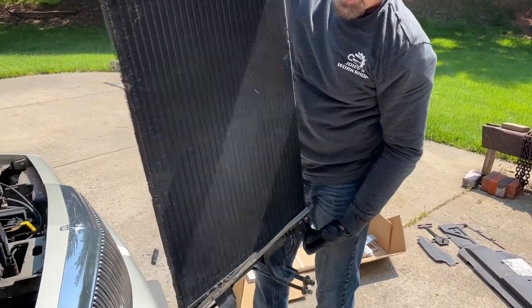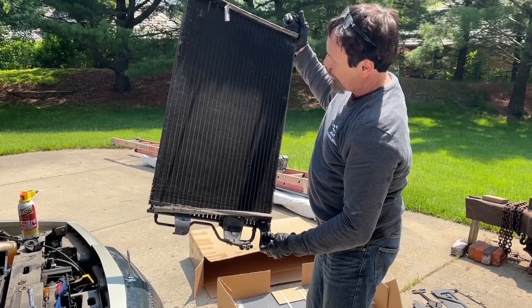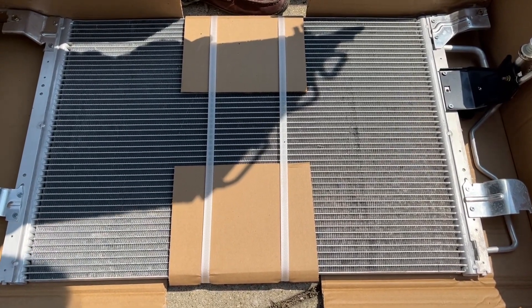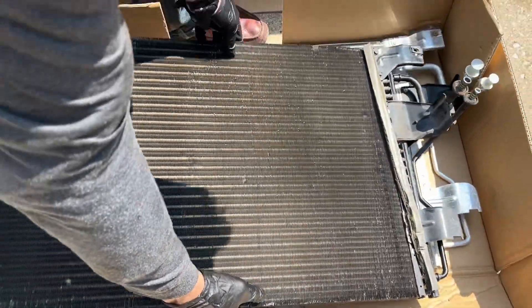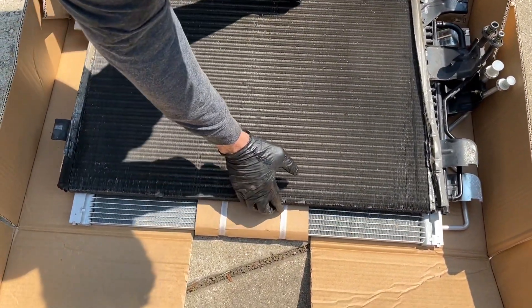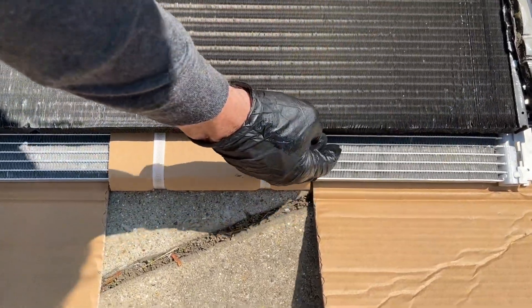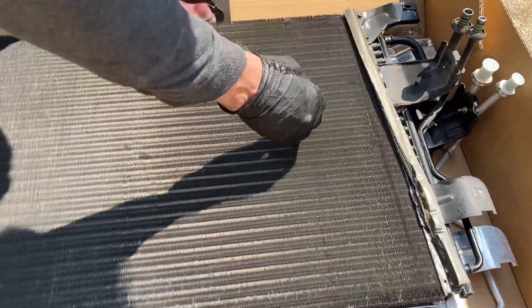What we were hoping to see was a big oily patch indicating where the leak was occurring, but unfortunately we don't see that. We've got the new condenser and we're going to put it in anyway — AutoZone provided this and shipped it straight to the house. Here's a comparison of the old and new parts. They look pretty similar and it should fit. You can see a slight difference in construction: the old one has long skinny tubes with fins between them, while the new one has tubes going straight across with fins running vertically. Otherwise it looks like the right one with the correct connection points.